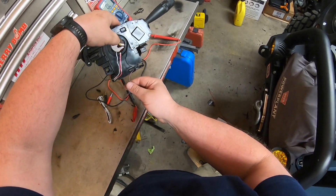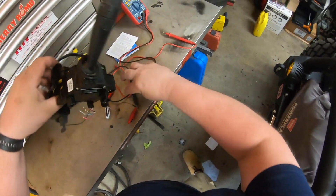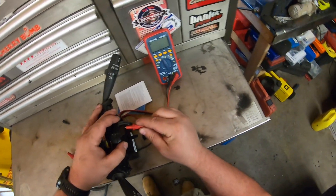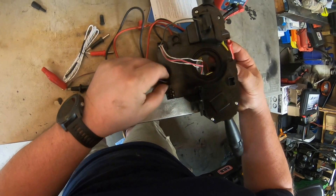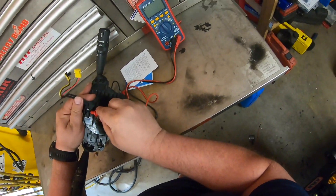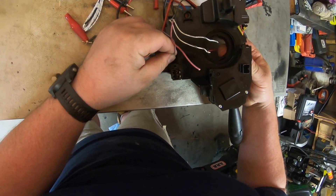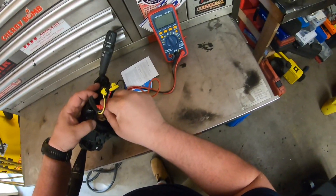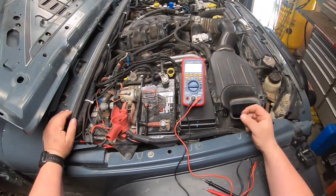Now I've got a wire in the back — let me get them clipped together. As I check for continuity, I go opposite leads — I had continuity there. Check — good, I got continuity there. Check here — continuity there. So that's how you use the continuity function to trace a circuit.